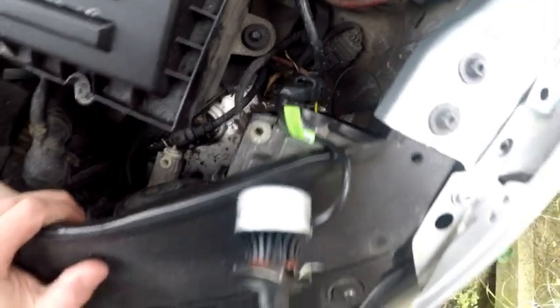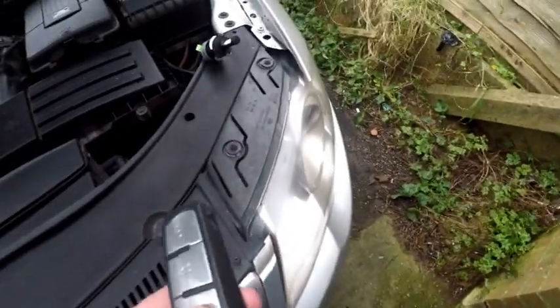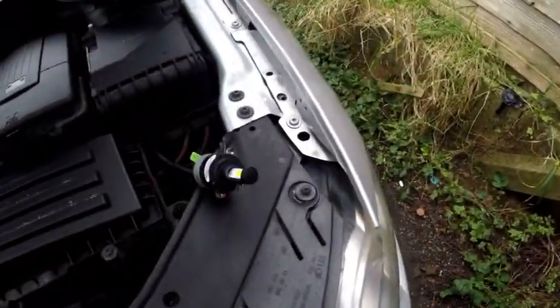As you see, I have just literally plugged in the wrong cable. I'm just going to go turn the car on — I can do it with my key which is quite handy. So that is the wrong way round because as you see the HID is warming up and that bulb isn't.